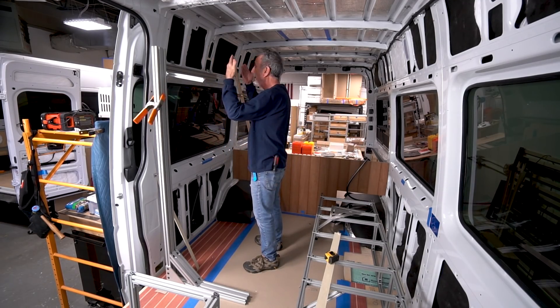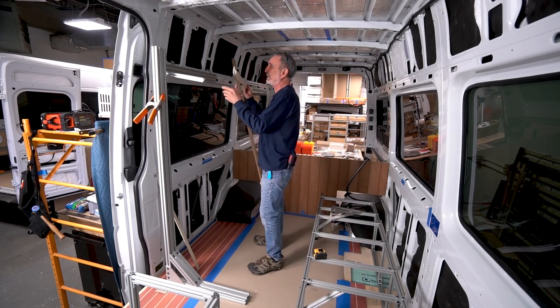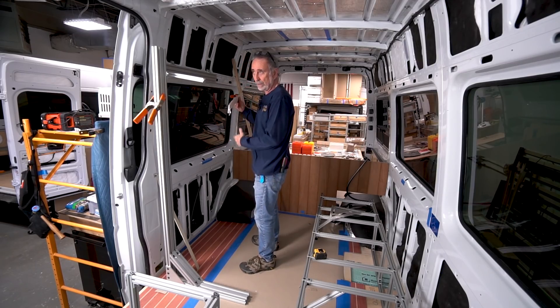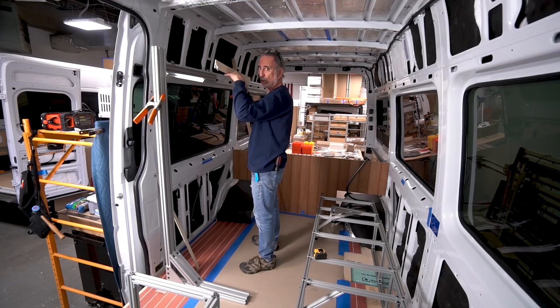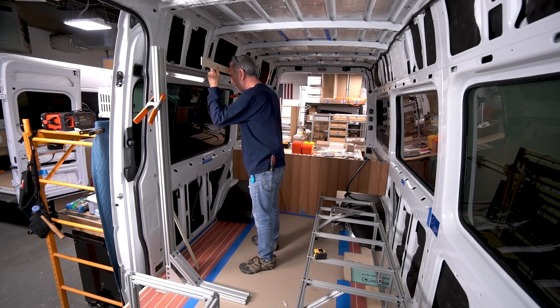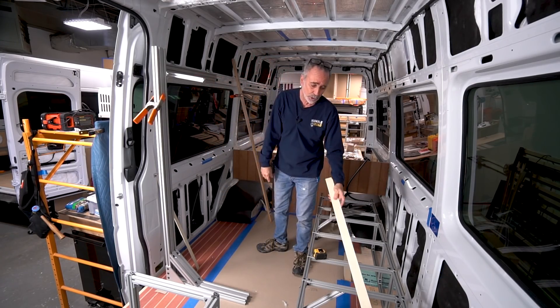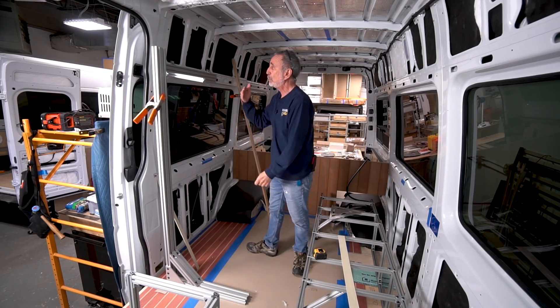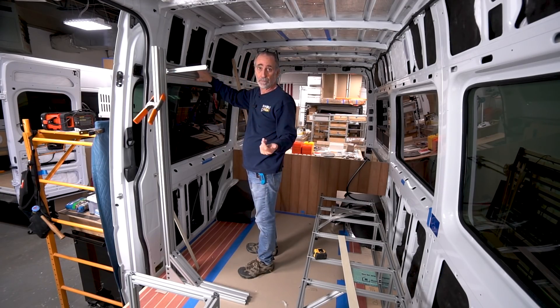Get yourself a piece of cardboard. Belly up to the countertop and bring that cardboard out to where you're going to feel comfortable at eye level. Because in the van, the wall cabinets are much lower than they would be in a residential situation — you would decide where you're willing to bump your head on that cabinet while you're prepping food. I'll go two to four inches short. Now you've got that measurement.